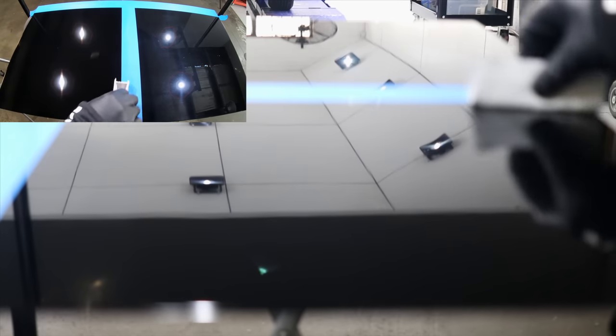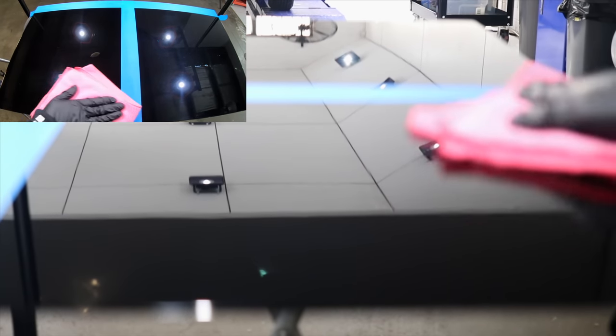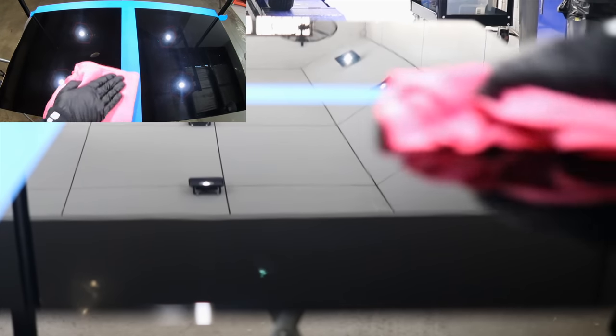But with that aside, I wouldn't say that this is a particularly difficult or especially easy coating to apply. It does lay down rather thick and have a bit of grip to it, and it may be a little more work to completely wipe or level down compared to some. But as a whole, I'd say it really sits somewhere in the middle compared to most ceramic coatings in relation to its user experience. And much like C-Quartz UK 3.0, it also seems to be a more rapid flashing coating with an almost instant bond to the paint. So it's going to be hard to screw up the application, even for first time users, as long as you work it in thoroughly to assist the flashing and then almost immediately wipe it down.